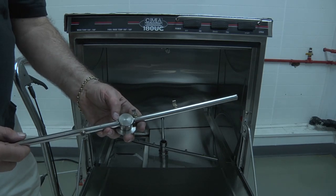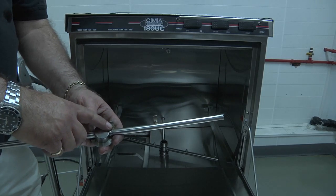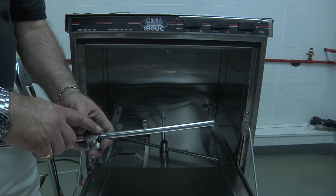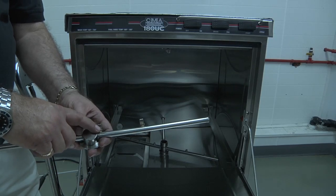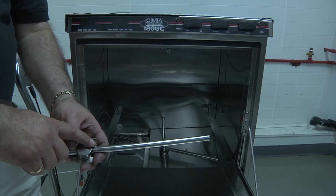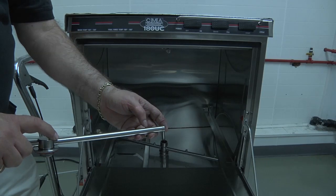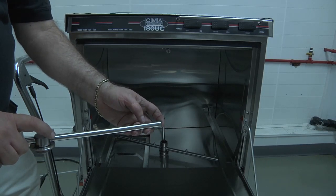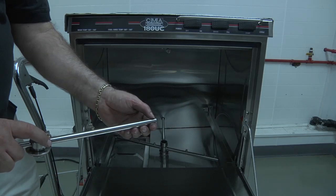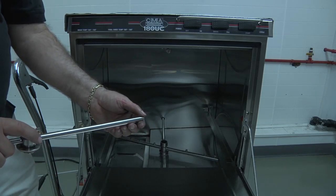Please remember, if you are going to be cleaning the rinse jets or the wash jets in either one of the arms, do not use any metal objects. Only use plastic or even a wooden toothpick to clean out the holes. Reassemble the arms. Remember to tighten the end caps because you don't want them to fall off during operation. If they fall off during operation, you will get water splashing out the front door, and that will be a sign that you would need to check the arms.